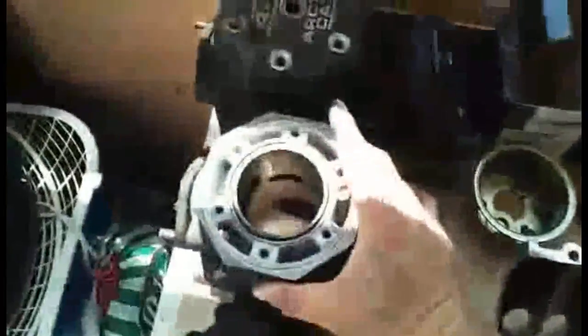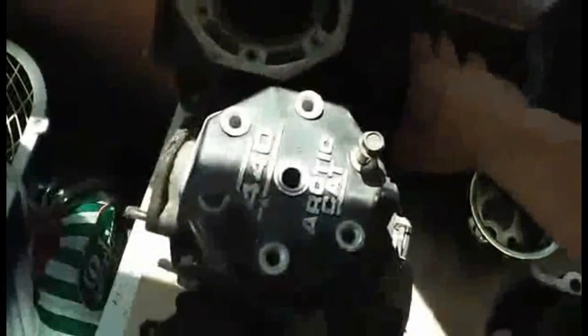Let's see if I can get it up here so you can see it. Cylinder's in real good shape, doesn't need to be honed — just cleaned up real good. Same with this one: cylinder's in real good shape, nice and shiny, doesn't need to be honed or anything, just wiped out.